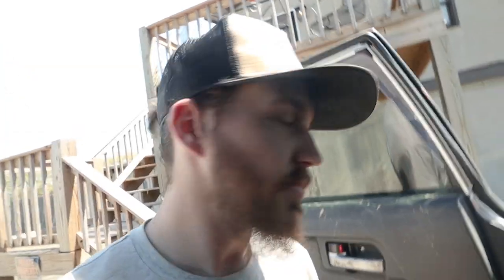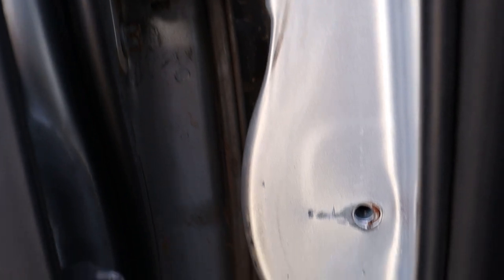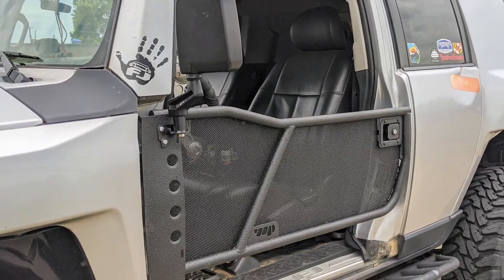These next two are vehicle-specific. Starting with the doors — if you didn't know, you can take your door off just like a Jeep. There are 5/16 pins; you cut the factory pin and throw these in, making it a quick-release pin for the door. I've got a pair of tube doors I put on sometimes in the summer, or I'll just ride with no doors. It makes it super convenient to pull those pins, drop the door off, and store them in the garage. I'll link a YouTube video that helped me do this. I got these pins at Tractor Supply for $6.